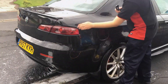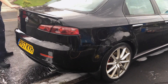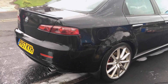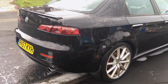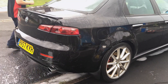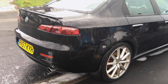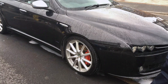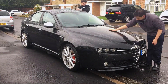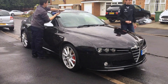The clay bar process is going to make one of the biggest differences to the car's paintwork and is really crucial in giving it a good finish. Lots of people don't know about clay bars, but I really believe it's essential for a truly perfect finish. Think about it — if you skip this and go straight to polish, all you're doing is working those contaminants further into the paint and working twice as hard to get them out. Just like the normal wash, use straight movements to reduce any risk of scratching.